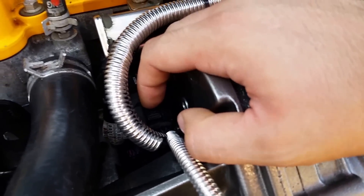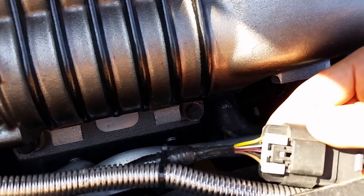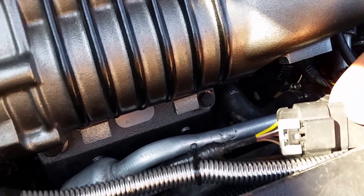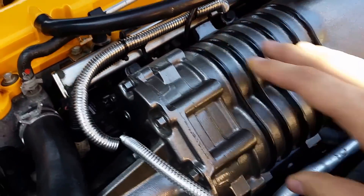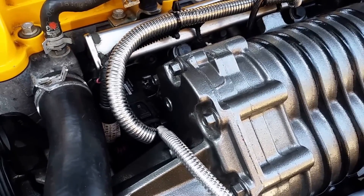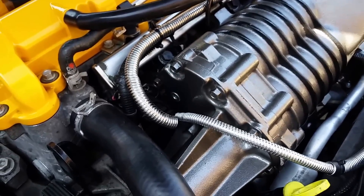The MAP sensor is now over here. I have a mass air flow extension that runs all the way back to the cold air intake. What I did was take the temperature reading from that and piggybacked it into the T-map sensor — so it's taking the T-map reading and putting it into the MAP harness, meaning my computer reads the IAT after the supercharger, not the cold air intake temperature. You care about the IAT after the supercharger compresses and heats the air. It's a stock LSJ sensor. Tell your tuner what sensor you're using and how your setup is, because it will affect your tune 100%.